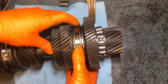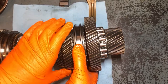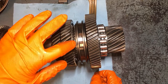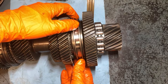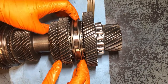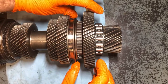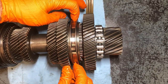This is the issue I think I have. I have to put a little bit more pressure — I tested and compared it to all the other ones to actually get this gear to stop. With light pressure I can still turn it with a little resistance, but on this one I put a little bit of pressure and the whole thing is almost locked up. So I think I've got a worn blocker ring inside here. Also, if you have gear pop-out issues, there are springs around here that hold this in place once you go in. My springs I think are a little tired — just that is all it takes and now it's out of gear again, and that took almost no effort at all.